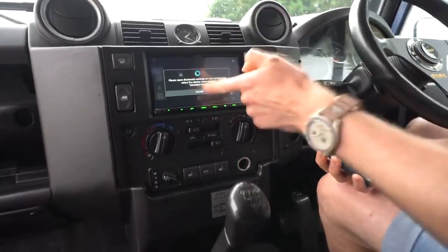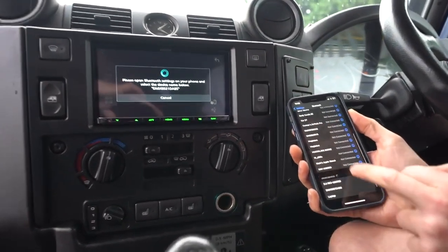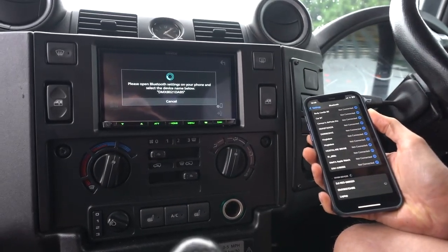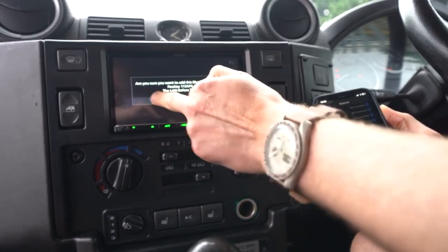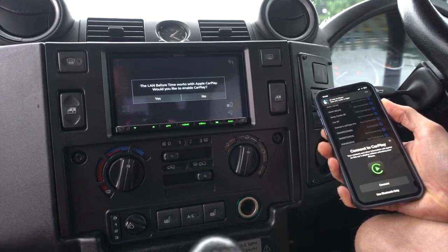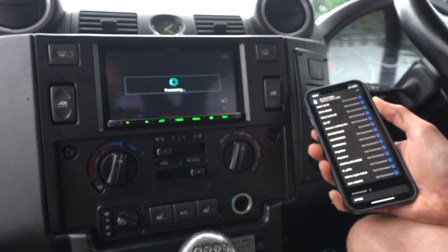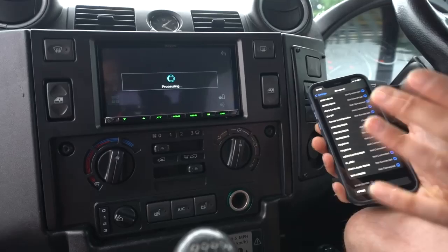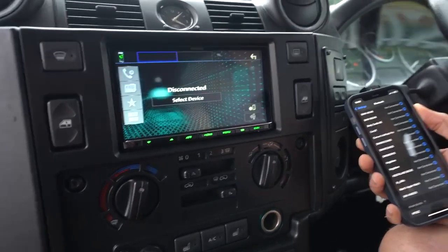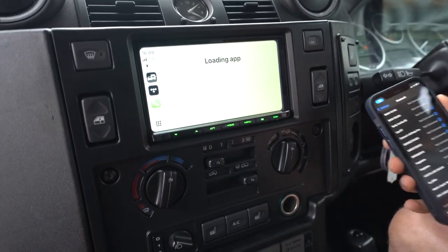I'm going to go into settings on my phone, go to Bluetooth, search for devices and look for the new one down the bottom — which is the 8021. Then we're going to hit pair, go yes on here, allow my contacts. What it's doing is a handshake via Bluetooth and it's going to say do you want to connect to CarPlay? You say connect on here and then agree on the screen — and that is it. You don't have to keep doing this; this is only for the initial registration. You can leave Bluetooth and Wi-Fi on and when you turn the key it automatically connects. And now CarPlay comes up on the screen.